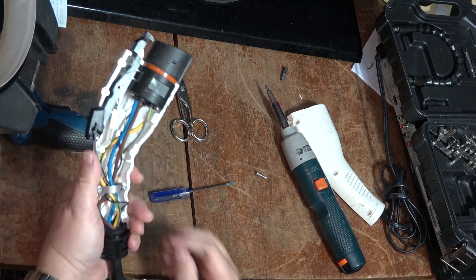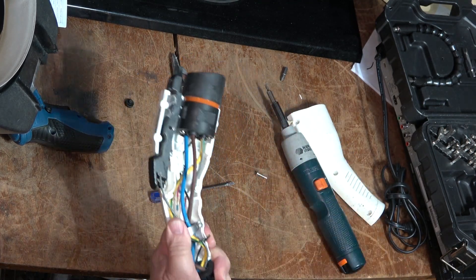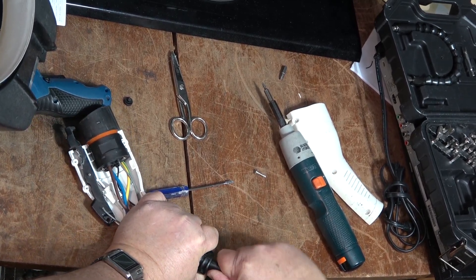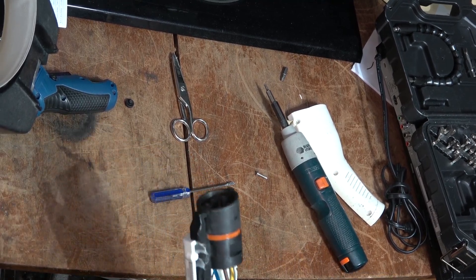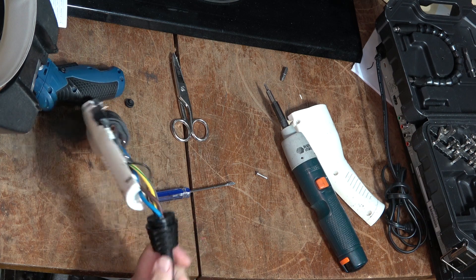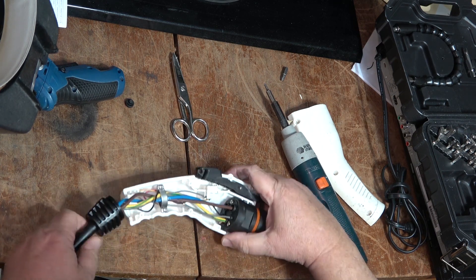This is not the Amazon charger I showed off before — this is one I picked up from someone selling it on Facebook for the second car. I had been using my stock charger which would run at 240V but was only 12 amps, whereas this one gives me 16 amps, which is what the car needs. The Volt only has a 3.3 kilowatt charger. I've got two of these 16-amp cables so I can charge both cars at the same time on basically 30 amps.